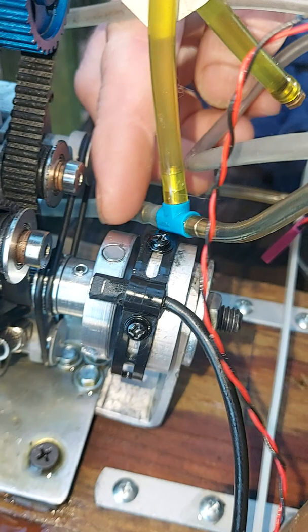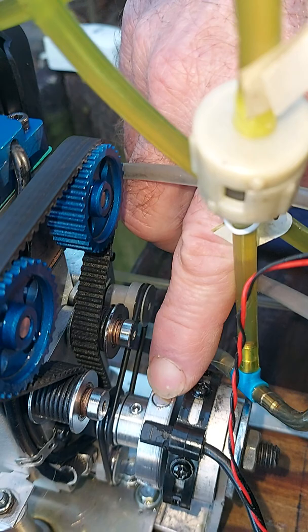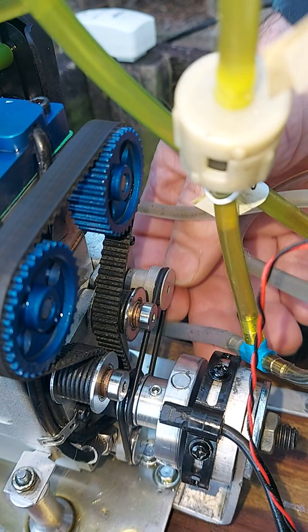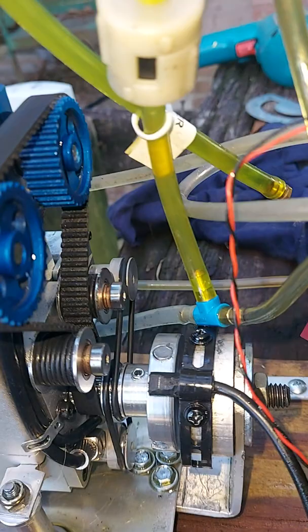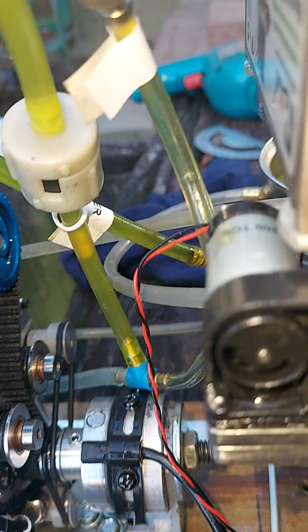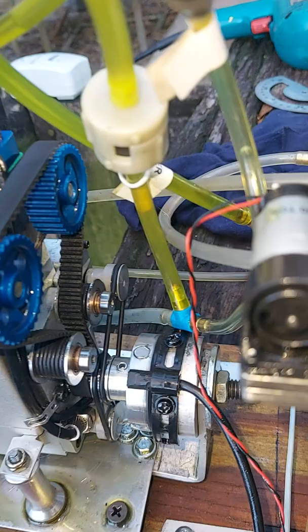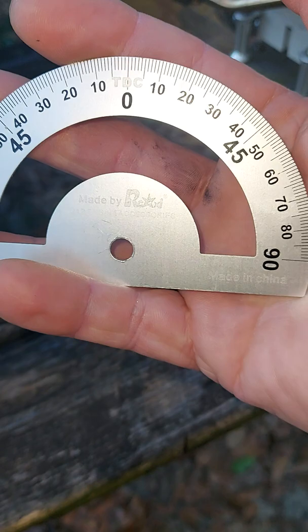And the magnet wheel setup is something I made on the lathe. I put the magnet, one of them facing where number one is, and the other one would face 180 degrees opposite. One's north pole, the other south pole. I don't know which is which, but south pole does, I think, 1 and 4, and north pole does 2 and 3. Could be the other way around. I am not sure. But I used this compass by RCXL Ignition.